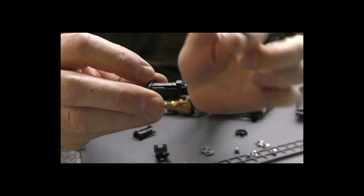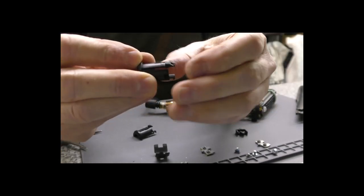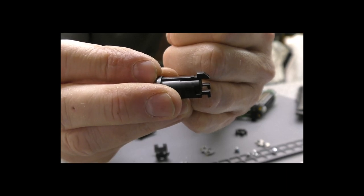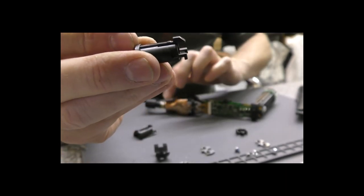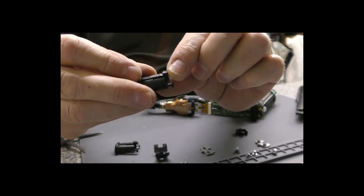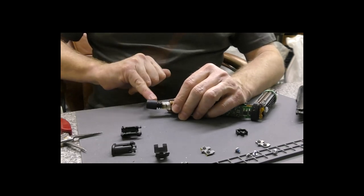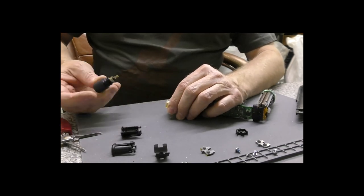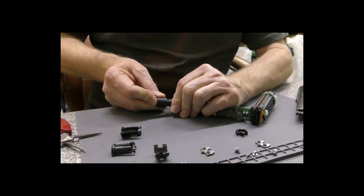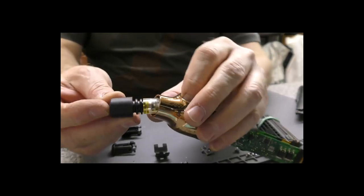See the piece there? That bit there is the piece that has got to be bent in. And when it's pushed in, it springs back up, and you can see it's quite a chunky bit of plastic with a very flat edge, and that has gone in behind the metal of this hinge assembly, so it will not pull out. And of course, you've got exactly the same on the other side, and you can see how that bends in. So do not damage this. You can then see the cable and the socket. Pull the cable out, tiny little bit of contact grease, this has got plenty in here already, and then finger behind the socket perhaps. Oh, it's quite a tight fit, and push it in so you've got no gap there.